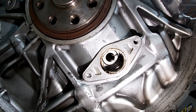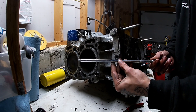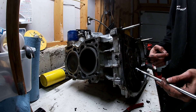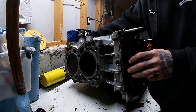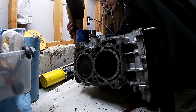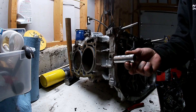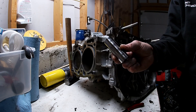We'll get that little clip out and get the wrist pins and pistons out. Now that the wrist pin clips are out, you want to get a really long extension — a quarter inch extension like this — something long and thin that you can stick through the wrist pin hole on the other side and basically hammer it through to knock the wrist pin out. We just pushed the wrist pin through this side with that extension and there it is. Let's go ahead and do pretty much the same thing for the other three and we'll pull the pistons out.